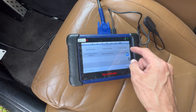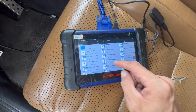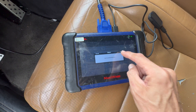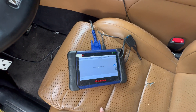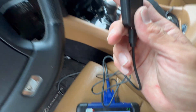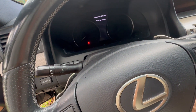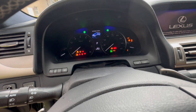We go here and do Generate Analog Key, hit OK, and load the LS460 file that we just saved. Now it's gonna be making the key. The analog key is complete — we can just take it now, put it against the push button, and press. As you can see, the car comes to the ON position, so we can shut it off now.